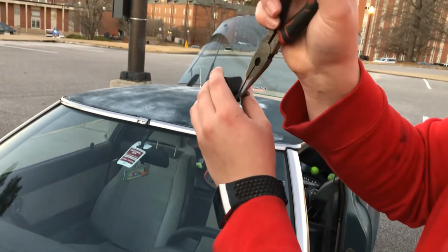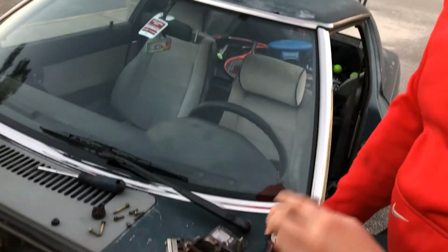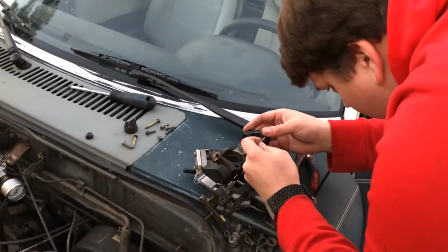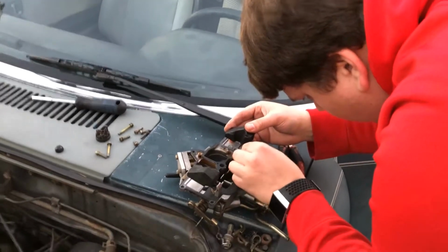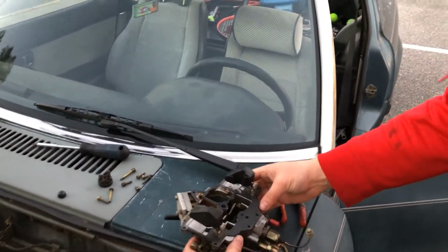See, this one needs to go down. Yeah. Yep, there. And depending on how y'all bend this, it'll do different amounts. If you grab the whole thing and bend it, that's the best way to do it. But if you grab the end, it's putting on a very fine point on the top of that needle. So if you bend just the end of that little tab, it may not actually move it much.